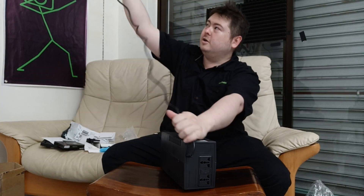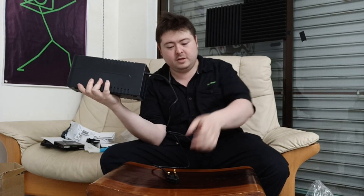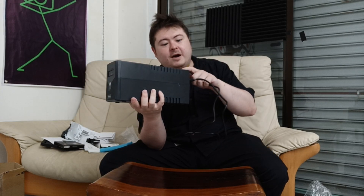The cable is a fairly decent length — a good meter, maybe a meter and a half. There's one button on the front. It's very simple: you plug this in, you turn on the mains, you plug in your computer, and you turn it on from here. When you're done, start shut down, turn it off from here first, then cut the power. If you cut the power first, this device will think your power has been interrupted and it will start running off battery or start beeping. So turn it on and off with this button, then the plug from the mains.